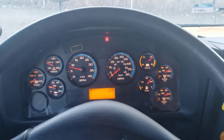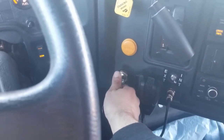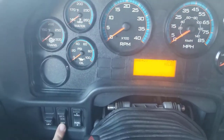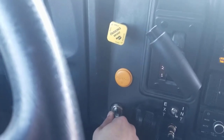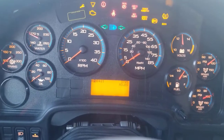For the air brake test, you're going to go ahead and turn the engine off. You're going to hear some beeping — that's okay, it's just reminding you that your headlights are still on. If you turn the switch off it stops; just turn it back on and put the key back into the on position — just one click to the right — and that'll make that noise go away. The engine's not running, but now all your gauges are working.